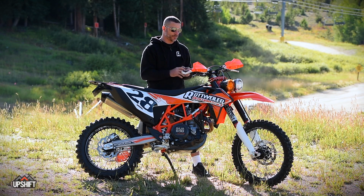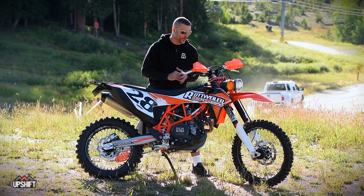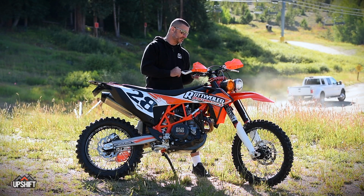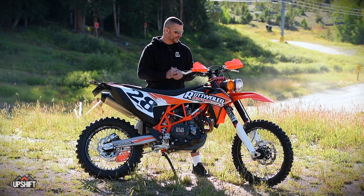As far as the controls department, we've got a Brembo RCS front master cylinder. It's a 14 size piston for the single-sided brakes, the billet brakes that are on there.